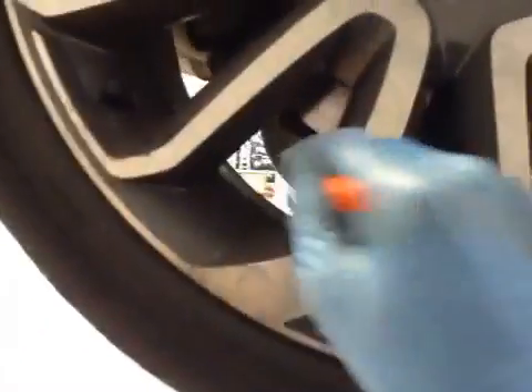This is the driver's rear tyre — the tyre is just below 5mm. No signs of foreign objects inside the tyre. The rear disc is in okay condition, and your rear brake pads are roughly on about 7mm. So the pads are in green, disc is in green, tyre is in amber.